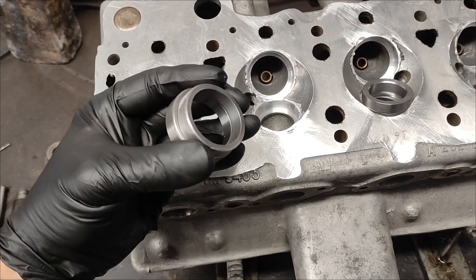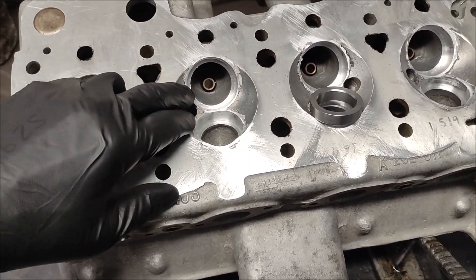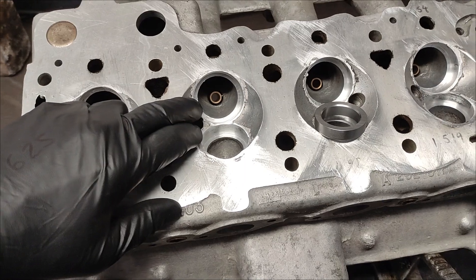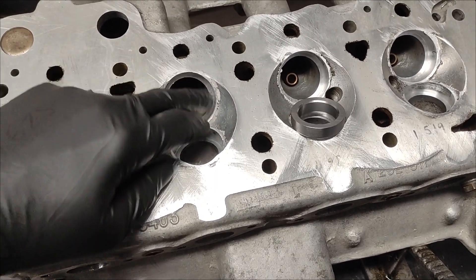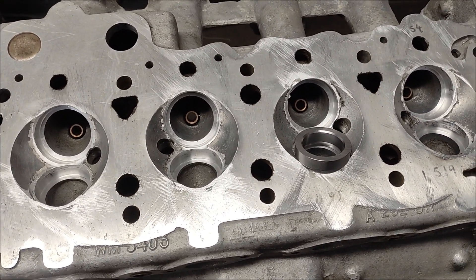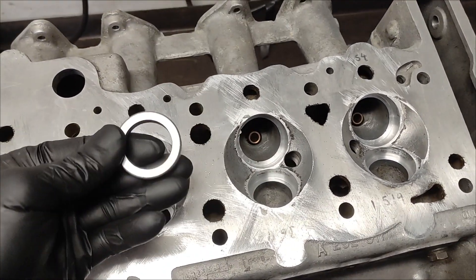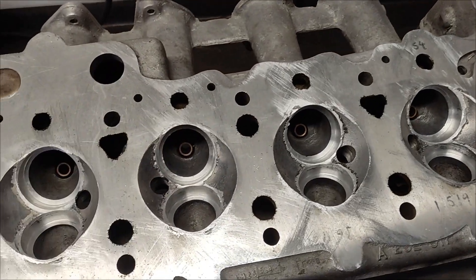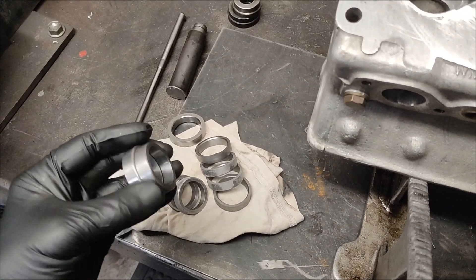You can see how much smaller they are. That's just to allow me to take the minimal amount of OD out of the cylinder head for where the insert seats. We want as much material around that insert as we can possibly get. Same sort of goes for the exhaust — that's what we started off with, and down here, that's what we've got.